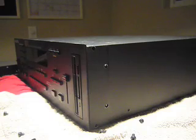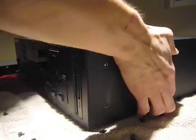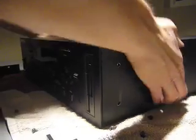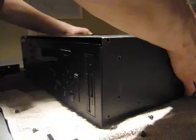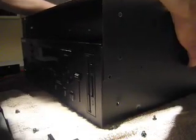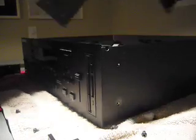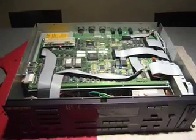It's in the serial number range of 13,000 or higher. I'm going to ground myself and unplug the machine. If you don't know how to ground yourself, Google it. If you need one of those wristbands, go get one. And look at the screws on the towel — see how I have them all laid out? That's because they go in certain holes. Make sure what you take out is what you put back in.